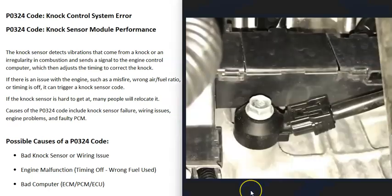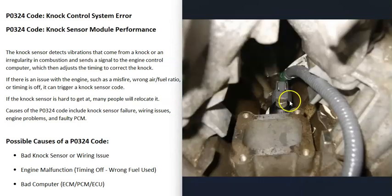What does this mean? Basically, there are knock sensors bolted directly to the engine. What they do is listen for any kind of vibration or knocking sound. If there is one, they report this information back to the computer, which then adjusts the timing a little bit until the knocking goes away. When you get this P0324 code, the computer is seeing some kind of problem with this knock sensor system, so it has to be troubleshot to find out why.